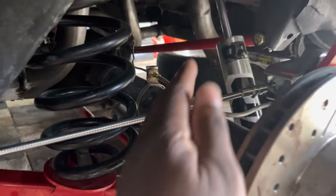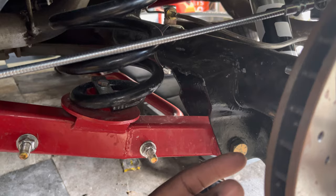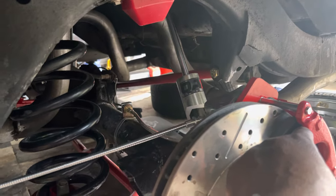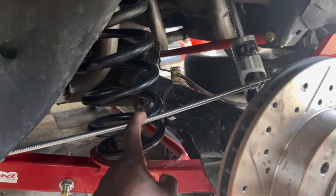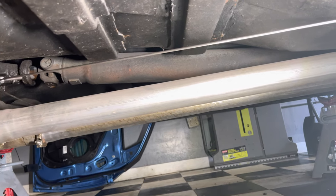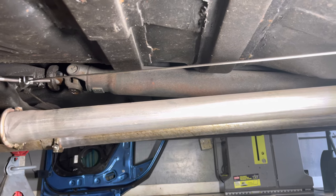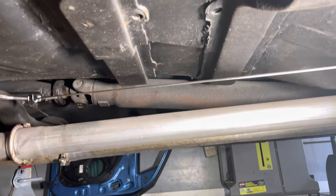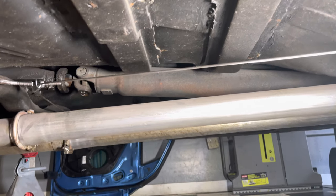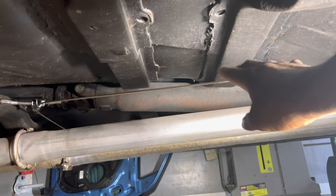Another thing to look out for with Wilwood: when you upgrade to disc brakes, the drum brakes actually had the e-brake cable on the bottom side, which didn't need as much cable line. But because the brakes are repositioned to the back, I had to get a customized e-brake line. The original one I ordered was not long enough — it was off by four inches. I did some research and called a company — I wish I knew their name, I'd give them props, they really helped me out. They said for my type of car, there's a line off a Chevelle — I think it's the '65 to '70 Chevelle — that fits perfect for the '66 Impala, and everything just ran through properly.